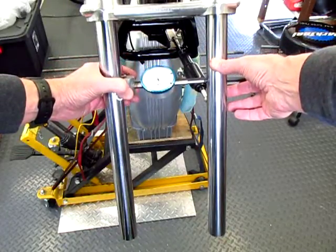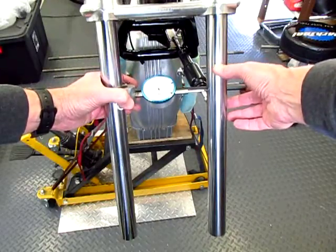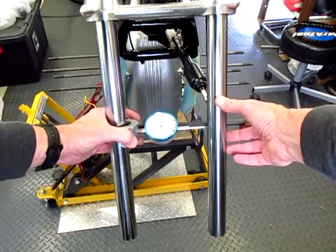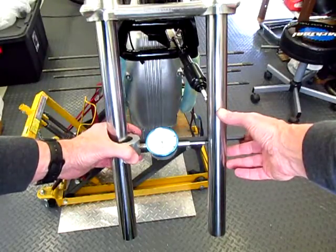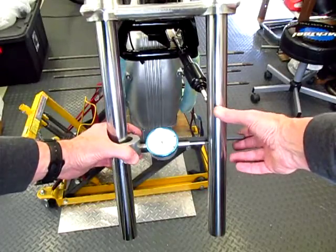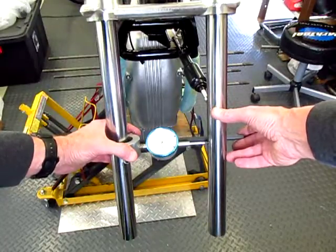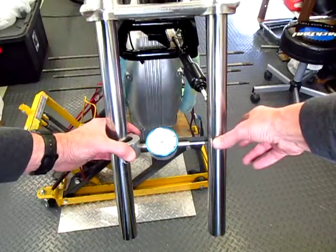As I get to the halfway point, there's really no deviation yet from the original setting. So I come down to the bottom — you want to be careful that you don't put bending forces on the fork while you move the gauge. Sometimes I have to adjust my hands to keep from bending them a little so that I get a true and honest reading.